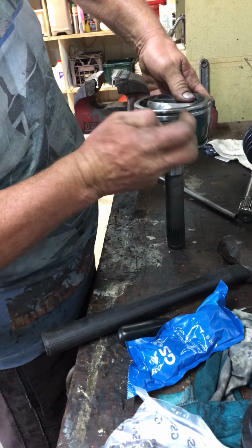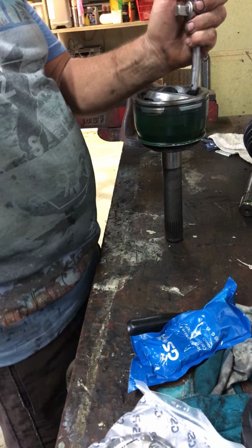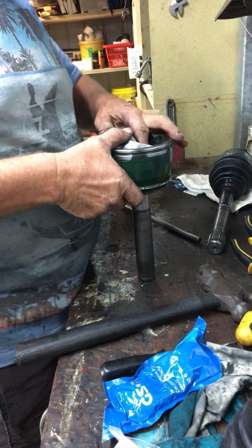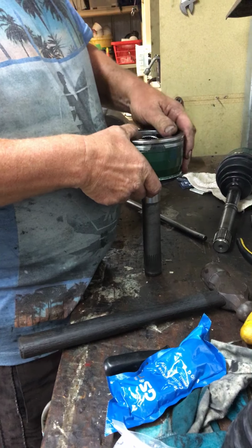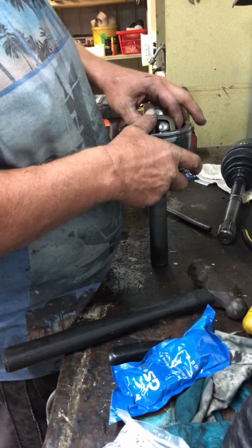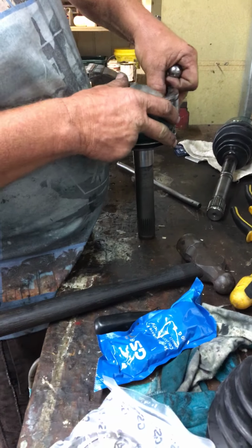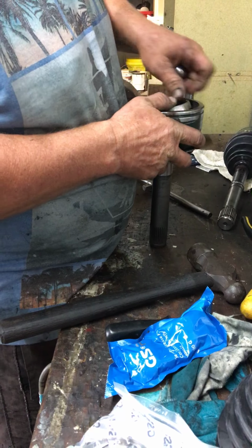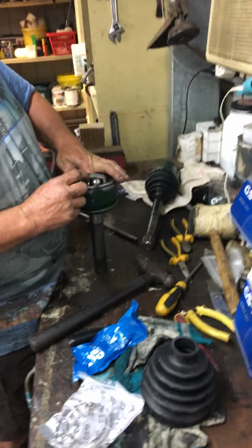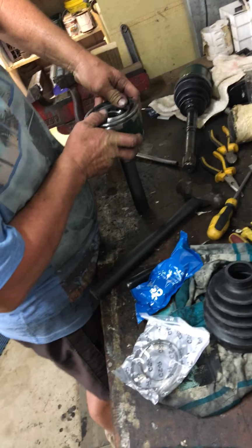I found because once I get a couple of ball bearings in here, it starts to get really firm to move around. So again, not ideal. I wish I had a piece of brass, like a brass rod or something, and I just tapped that down and tapped it out of place. So you work your way around and start again. That's all good. Again, line that up, get that in, up she comes, ball bearing in, down into place. Get everything nice and straight, drop that down, 3 ball bearings into place. Then it starts to get nice and firm.